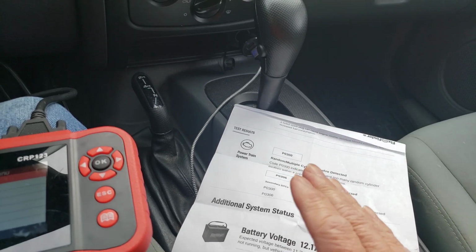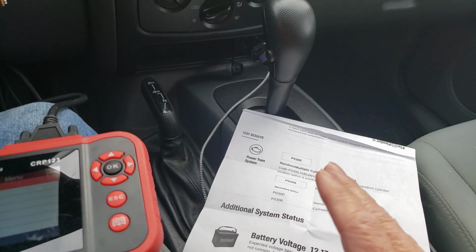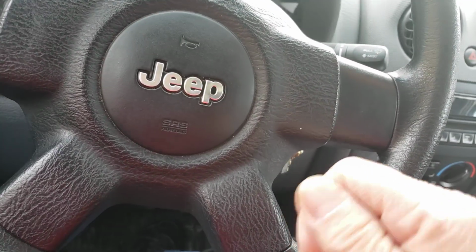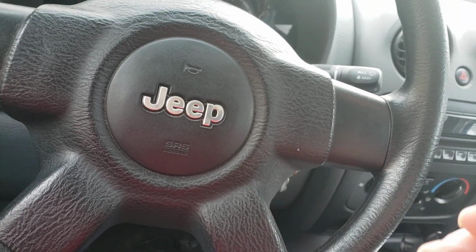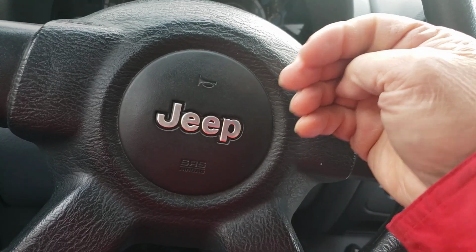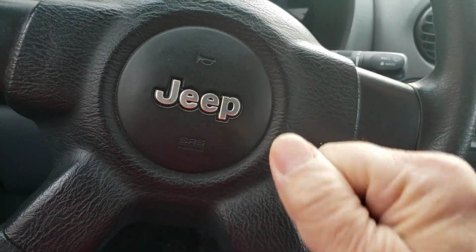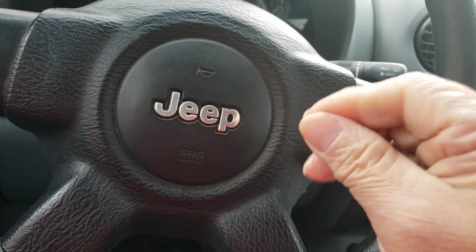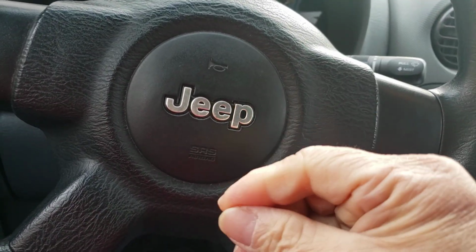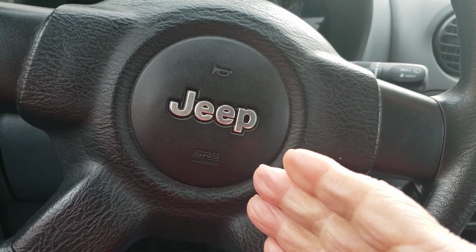It is 23 degrees out here. It's cold. It's below freezing. Water does not burn. So in case you had a little bit of moisture in the gas tank, maybe running the fuel lines going towards the engine, maybe it's in the fuel line, below freezing, that little bit of water turns into a little ice cube, a little blood clot type of thing, you know what I mean? When that falls into that one cylinder, it's not going to fire because water doesn't burn. It'll give you the little misfire code.